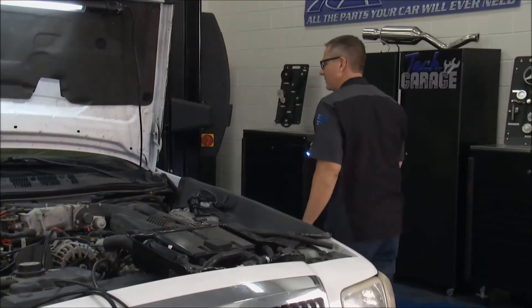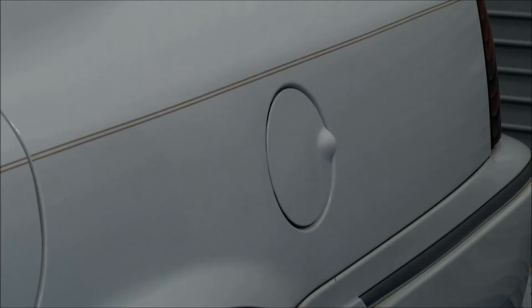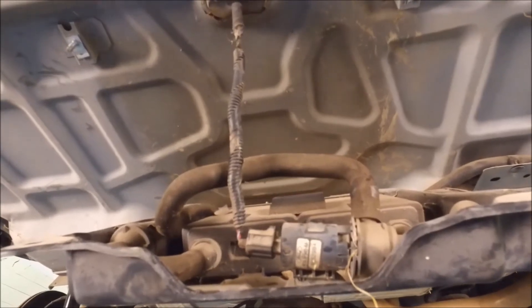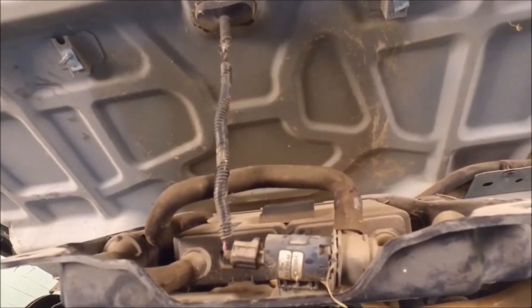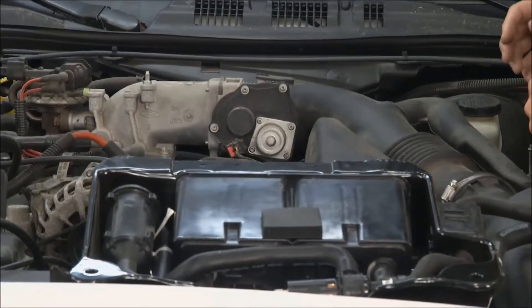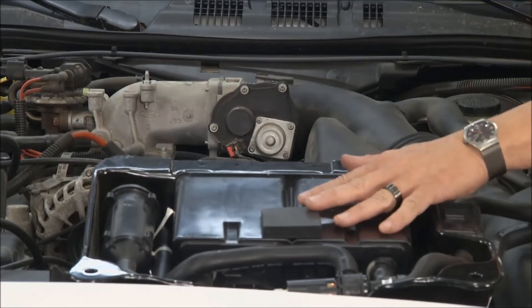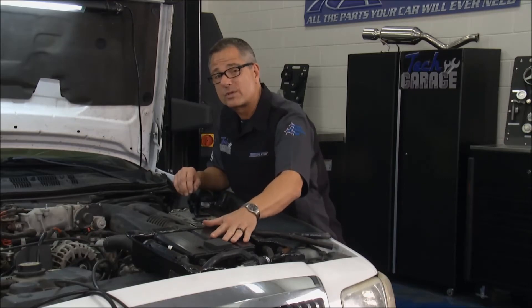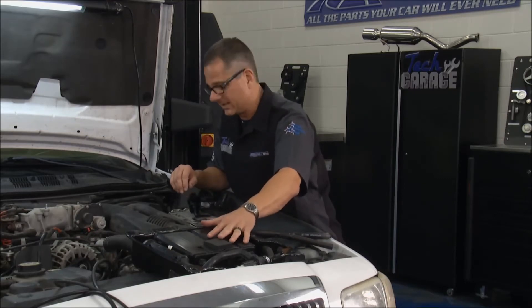We look around the purge solenoid and up top here, running back to the car. I don't see much here. You keep introducing the smoke, I'll take a peek back here. Gas caps are very common. Nothing there. Smoking under the car, Tom — you know what that means. We have a whole system that's underneath the car, and the whole system is located right here. This is actually the charcoal canister, and the charcoal canister is what stores those evaporative emissions. I'll show you that in a second.